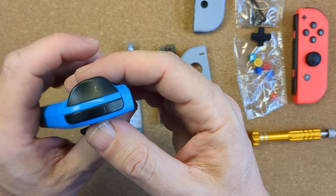Back to the Joy-Con — having tested the UPIO screwdriver successfully, I swapped to the WowStick with the Y1.0 bit and quickly removed the four tri-wing screws on the back of the Joy-Con. I then used the separator tool starting at one corner and making my way around the edge, feeling the sections pop apart. A slight twist will lift it away but be careful of the two ribbons connecting both halves. Remove the battery by lifting it with the spudger, being aware that there is some double-sided tape holding it in place, and carefully pull the wiring away from its clip.